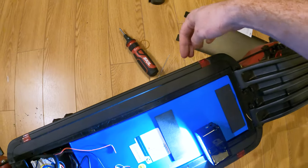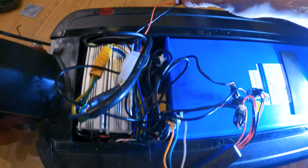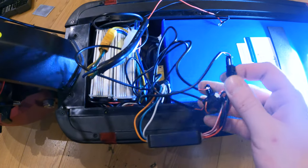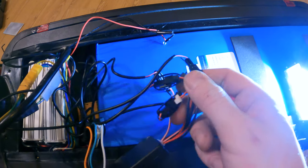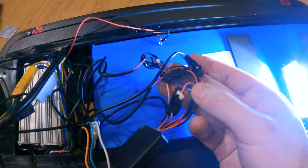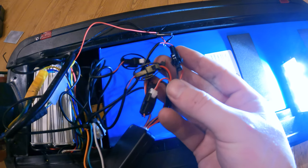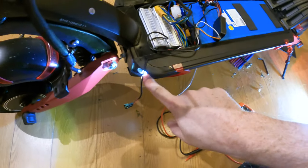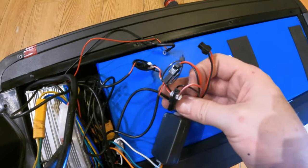I've got the lights back on and the tracker back in place, with the positive and negative fished out through that little hole. My objective now is to test wires with my multimeter and find a positive and negative. There are four clips here — this looks like a step-down converter — and four lights on the scooter, so I think these are the two tail lights and two headlights. I turned the scooter and lights on and confirmed that one light was out because I unclipped one connector, so these four clips are definitely for the four lights.